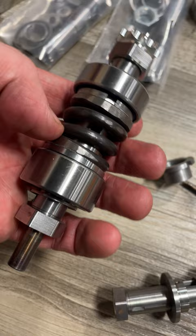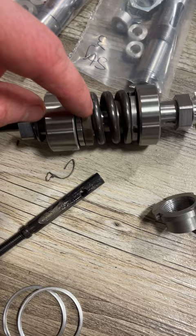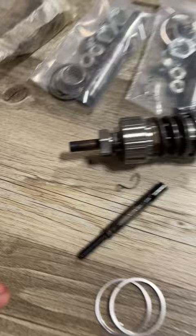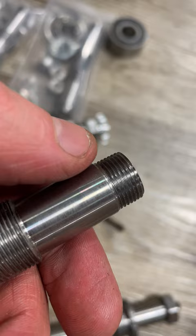Making my own nuts means I don't have to rely on China to get these parts, and I can actually supply assembled units — which is what people want. For clarity, because a lot of people don't really understand how these work: normally there would be a bearing this size on this side, but in order to put this wider bearing on, the shaft on this side is five millimeters longer because this bearing is five millimeters longer. There's also a slight cone shape for about half an inch on each end of this section of the shaft.